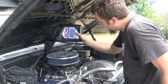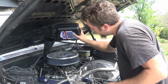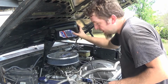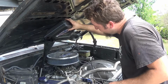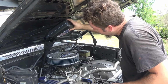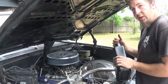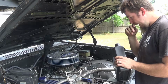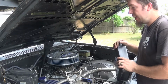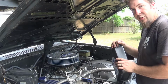My summers are 90 plus degrees. At 75 to 80 degrees, when I installed the external transmission cooler in line with the factory radiator cooler, it would run about 185. Probably run a little bit warmer in this tent. These temps, so hopefully the extra fluid will not only help it stay cool, but help it perform a lot better. Start it up, run it through gear a couple times, let it move around, move it to an even solid surface, check it, make sure it's on the dipstick somewhere, drive it, let it get warm, then finish topping it off.